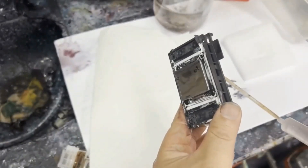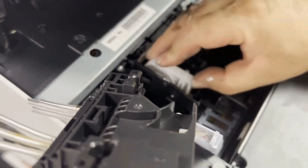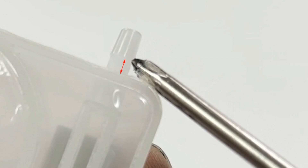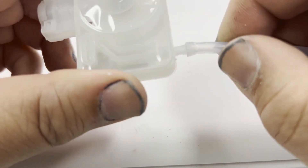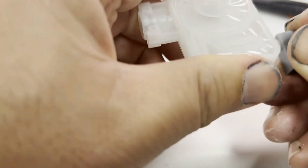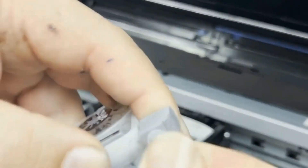I'm just showing you — you have a nipple now, so you can do those things. We install the printhead back to the printer, and then we insert the V2 damper. Now on each damper, we're going to insert an adapter. Here's the ink intake and here's the end of a barb. There's a distance between the base and the end of the barb. Your kit will come with a piece of C3 tube. Put this tube a little above the barb — about half the distance from the barb to the base. Then we cut it a little bit above the barb. Basically, the tube looks like it's divided by half: half in the barb, half not — it forms like a cone. Now we can insert the adapter. You want no gap between the adapter and the base. Then take the small sleeve and insert it in the small hole like this. Put the adapter on all the dampers.